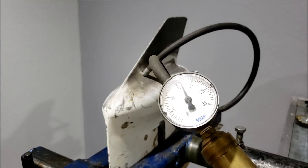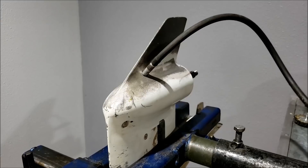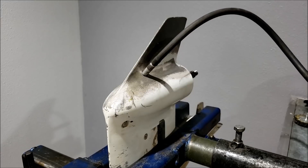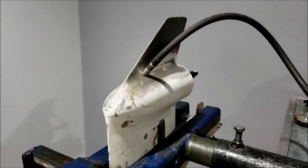After fiddling with the shift rod, the drive shaft, and the prop shaft, the pressure hasn't dropped at all. So I don't think we need to reseal this gear case. Therefore, I'm not going to. I'm going to continue on with the water pump, paint it, clean it up a bit — ideally you clean it up before you paint it, but you know what I mean — just clean it up, paint it, and reinstall.